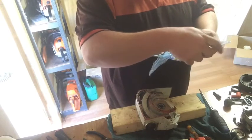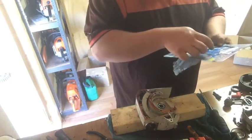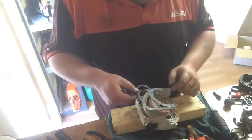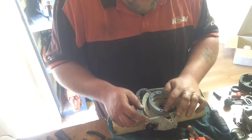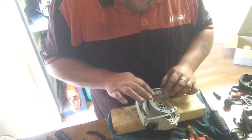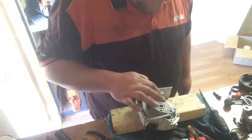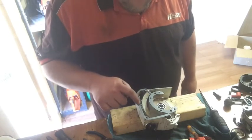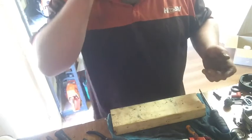Only reason I reckon you get a fuel tank leak is for storing them dry after the season ends, and then filling them with fuel, you know, 9 months later. Slightly bigger, this gasket. And yeah, storing them dry, they dry out, start cracking, whatever. Slightly different design too. Then filling them with fuel 9 months later, they go soft and they start leaking.